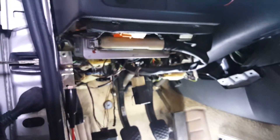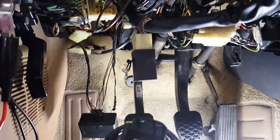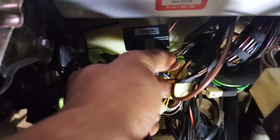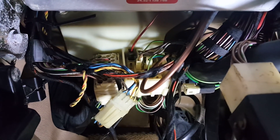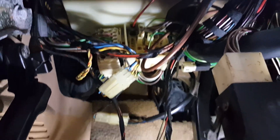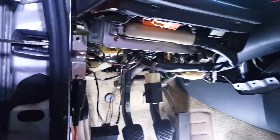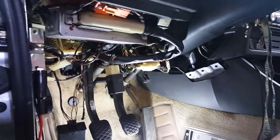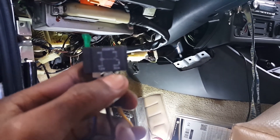After I fish those through, I also need to fish through the MAP sensor for the boost gauge, which I have right here. This will sit right up underneath here because this seems like the best location — I don't have to run anything other than a vacuum line outside, which keeps things simpler and also keeps it away from the heat. To install one of these gauges the proper way — as I spoke with my fabricator about — you need a relay. For this specific gauge it needs a 30-amp relay.